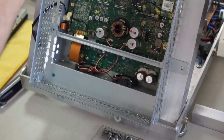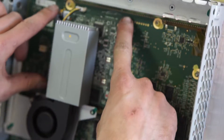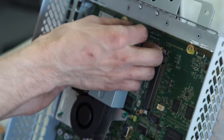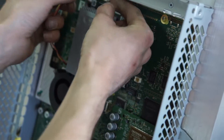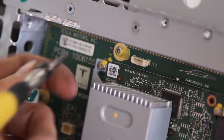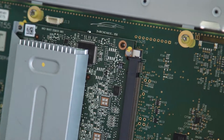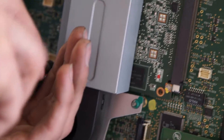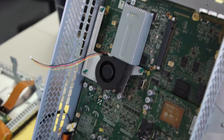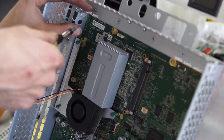Next is the Tegra board right here, which has the EMMC flash chip on it. To get to it, we're going to need to remove this CPU fan cable — sometimes a good old pick will do it. Then I'm going to remove these screws, starting with this one — this is the T8. Sometimes the little motherboard standoffs do spin when you try to remove the screw; if that happens you can stick a thin pair of needle nose pliers in there to keep it from spinning.